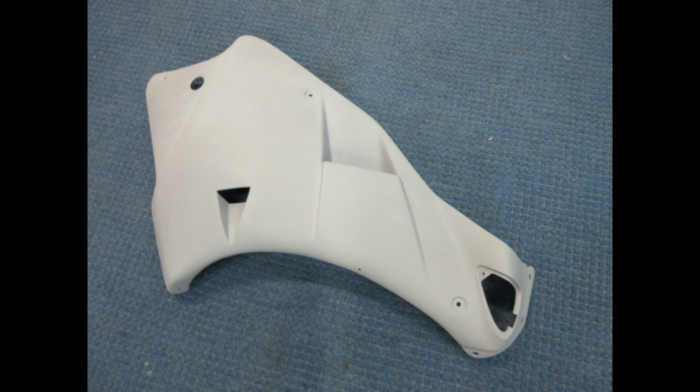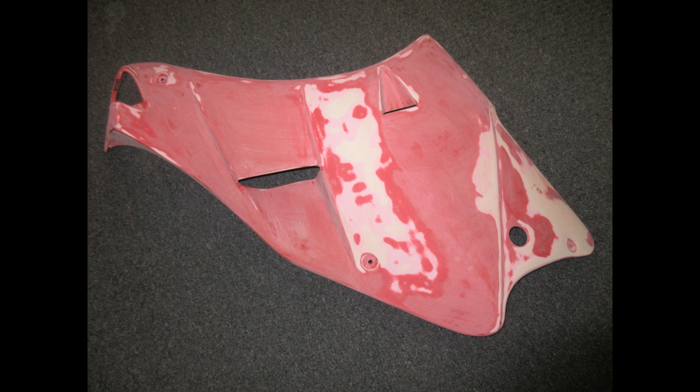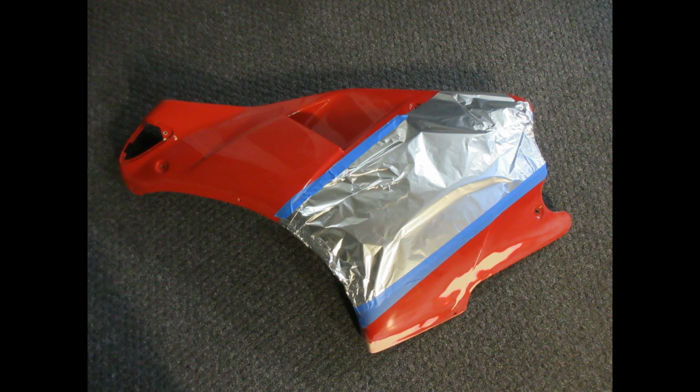Now, these are just some random photos from our channel to explain or to show. This is a part we did for Joe Padula's Ducati 888. It needed to be roughed up. No part of this was shiny when we put the first coat of prime on. The primer itself is primer sealer because we're dealing with that kind of a surface.